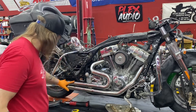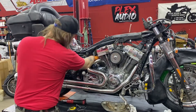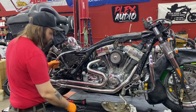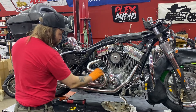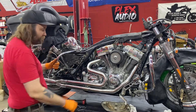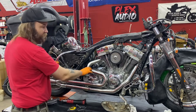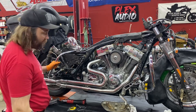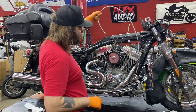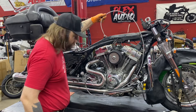Now we've got this all tightened up — we've got two little stainless springs to put in on the back to hold this together. Now we've got our exhaust installed. We've got to plug in our Thundermax EFI module and our O2 sensors, and run the harness along the frame for the front one. We're going to run our hydraulic line down to our clutch slave cylinder so that when we tie up our wires for our O2 sensor, everything gets tied up together nice and neat.